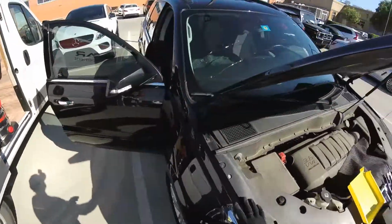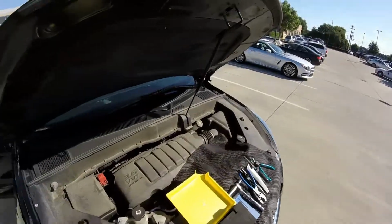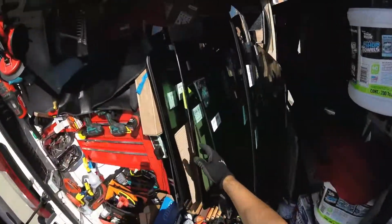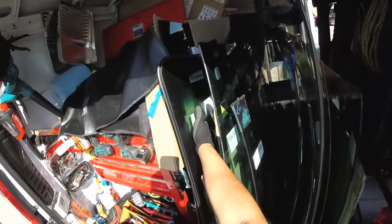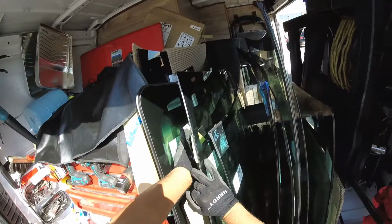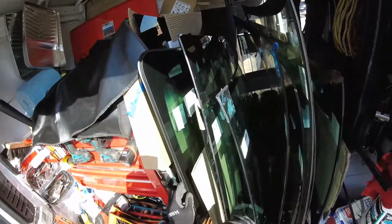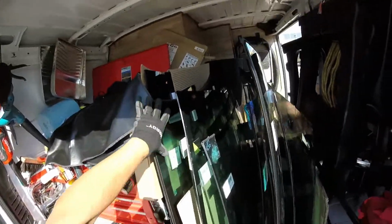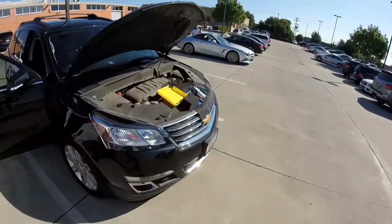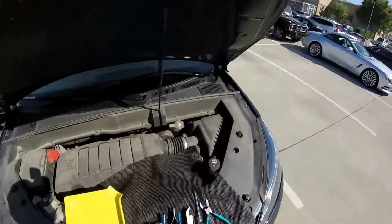Remember, we have this 2015 Chevy Traverse. Remember, this one for the 2008 to 2017 is the same glass. We're gonna use our DW 1712 GTY. Remember about the GTY, because GTN is the green tint and white, and GTY is coming with attachment for your moldings on. GTN means not coming with moldings, so that's not the case.